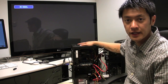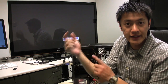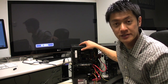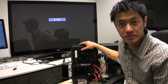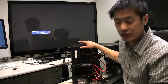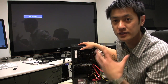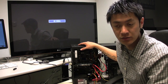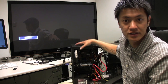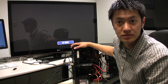Alright, I just finished upgrading my AMD system. One thing you should always do is wear an anti-static strap to ground yourself to the chassis. I was not wearing one during this build — that's very risky and I do not advise it. Static discharge can ruin sensitive electronics. Mine was at home so I had to take the risk, but I constantly touched the chassis to discharge any static.